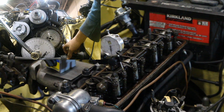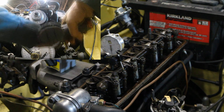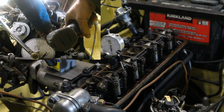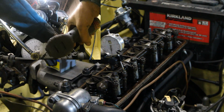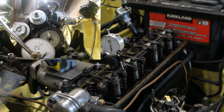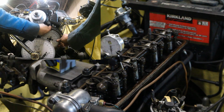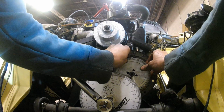That's it. Here is the time to talk a little bit about the 4 holes on the timing gear for the camshaft. This is specifically for this engine, for TR2, TR3, TR4 and TR4A. These 4 holes are actually 2 sets of holes for the screws that hold the gear to the camshaft. And these 2 sets are not at 90 degrees one from the other, they are at 92 maybe, something like that. So when you put your chain, if your gear doesn't fit perfectly there, don't turn any of the shafts, the crank or the cam.